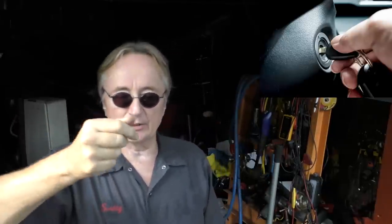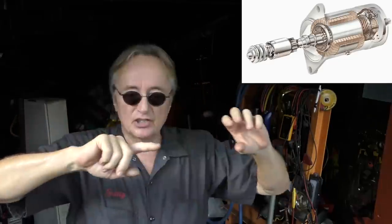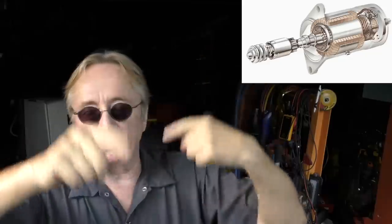But if the car is already started and then you hit the starter again, as that Bendix drive pops out it's generally going to mash against the spinning flywheel, make horrible noises — chink chink. That's not a good thing. If you do it many times, the gear on the starter and the Bendix drive will start getting chipped. But that's the least of your worries, because starters don't cost all that much and can be easily replaced.